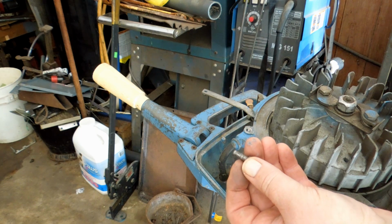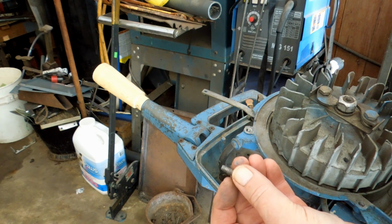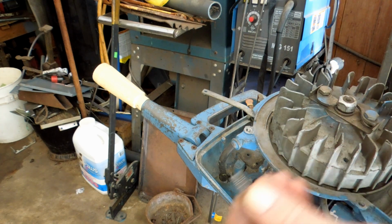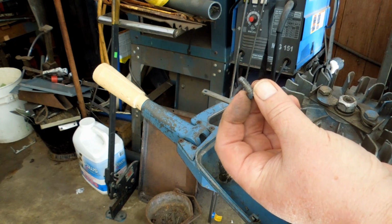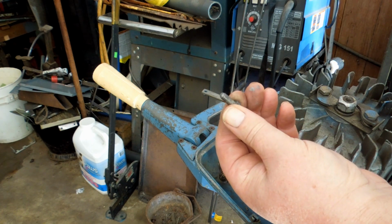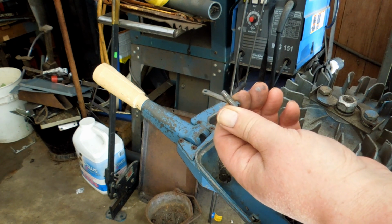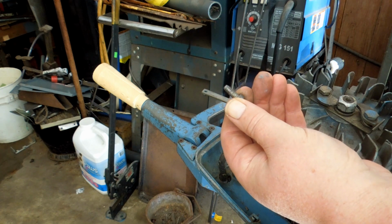Looks like the helicoil is just a little tight on this, and this is plated, so it's actually scouring the plating off of it. We'll see how well the stainless fits in there. I bet this is made to spec, but spec has tolerancing, and tolerancing on this one probably runs a little to the high side. Quite often they thread the bolt and then they plate it. It stays within the tolerance, but it is very snug.